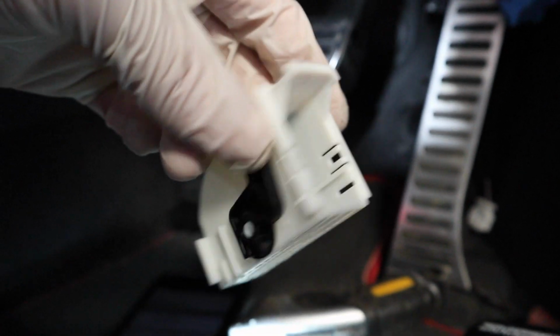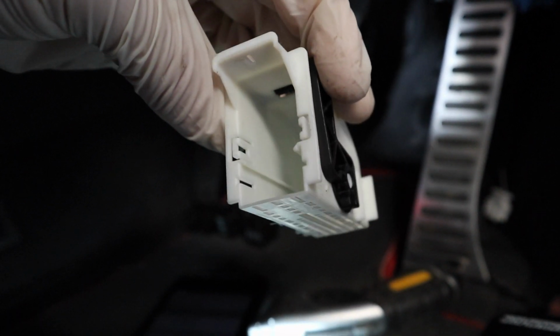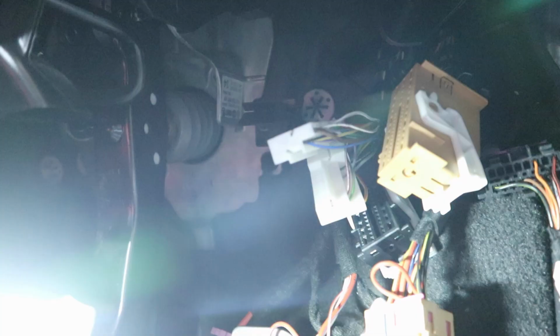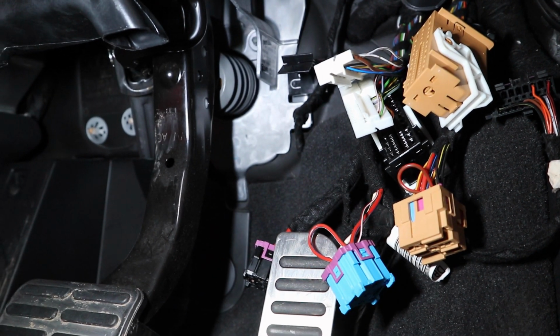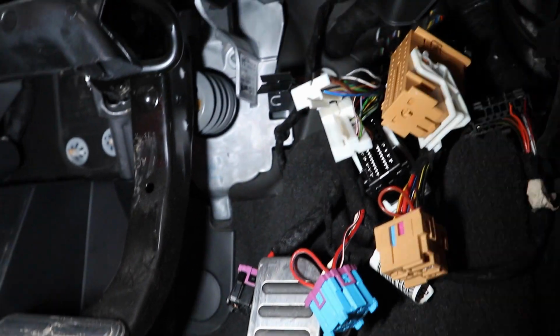I mean, this will be different for most connectors. Every connector will have a different tag on it, different lock on it, but as long as you find that lock, it's fairly simple to work out. If you can find what's holding it in, pull the connector out, and that will reveal the connector a bit more clearly. So the diagram said it was pin 29 on this connector, and that the wire was grey and yellow.